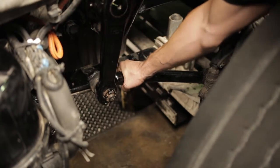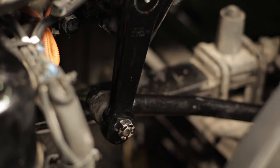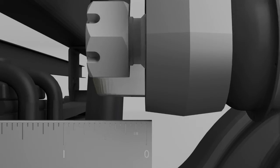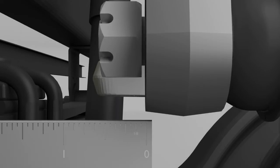To check the soundness of the joint, use your hand to push and pull the tie rod end in and out in the direction of the ball stud. For inspection purposes, hold the linkage without twisting while applying no more than 100 pounds of hand pressure force. Measure the in and out motion on the ball stud axis with a scale. If the total in-out motion on the stud's axis measures more than one-eighth of an inch or three millimeters with hand pressure only, then the vehicle should be taken out of service. If it moves but measures less than one-eighth of an inch or three millimeters, it should be replaced at the nearest practical service center. Any movement less than one-eighth of an inch or three millimeters is strictly a maintenance issue for the vehicle.